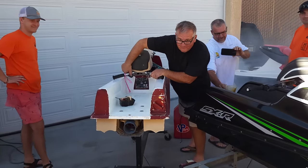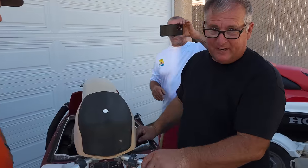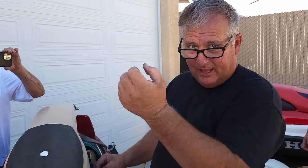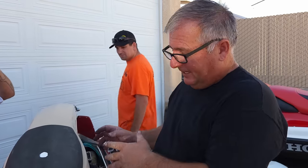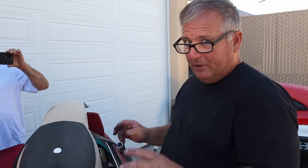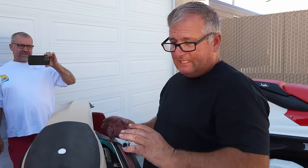So, tell us what you're doing pouring that down there. Oh, the motor hasn't run in 25 years. There's no oil in it. On a two-stroke, the engine takes the oil out of the fuel and separates it. So, it's been dry for so long, all the oil has run out of the motor. So, you have to put a lot of oil in it to get the system started. Otherwise, if we were just to go ride this, it'd last about a day or a week, and then it would start spitting bearings out. Okay.